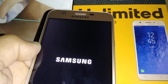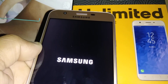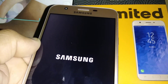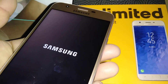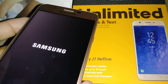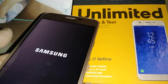It will take about five to eight minutes to reach the initial setup — be patient. If it takes longer than eight minutes and stays on the Samsung logo or Android logo, something may be wrong with the phone and you may need to calibrate the motherboard. In that case, long-press the power key for five to ten seconds until the screen goes off, then perform a hard reset using external keys by following the instructions in my hard reset video linked in the description.